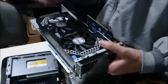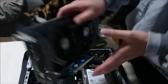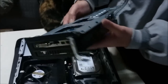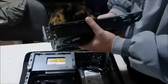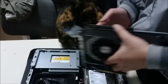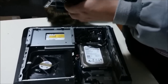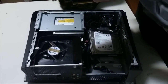With the graphics card, there's a blue tab. You have to open the blue tab first, and there's a button on the other side. Pressing that button will enable you to remove the graphics card. Note: it may be a bit hard to remove if the case is bent or damaged, but for a proper undamaged computer it should be easier.